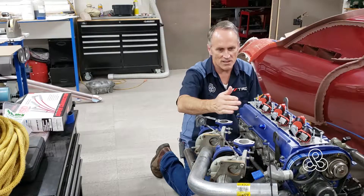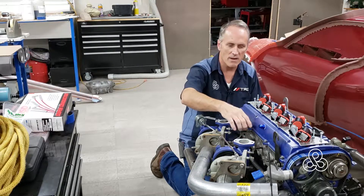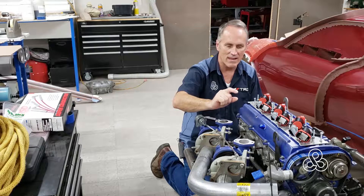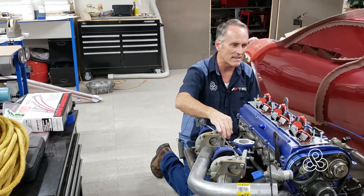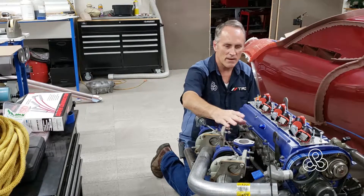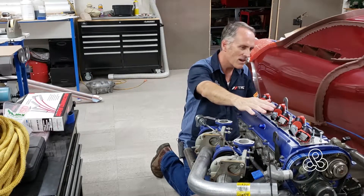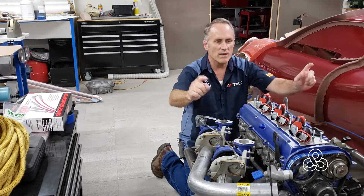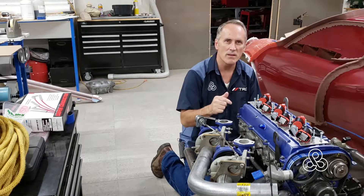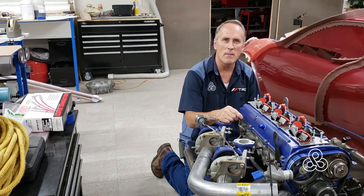The turbos are installed and the exhaust system is getting laid out. Next we need to build the actual exhaust system coming off the engine into the turbochargers. The exhaust manifold will be cast in stainless steel off-site, as I can't do stainless steel here. Then we'll have the pressurized side coming off the turbos into a merger above the engine and into the intercooler. There's still a carbon fiber cover to build for the plenum and suspension pieces coming for the subframe. Lots of videos ahead — subscribe and hit the bell icon to follow along.